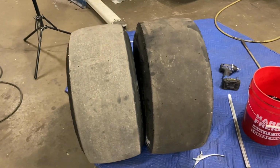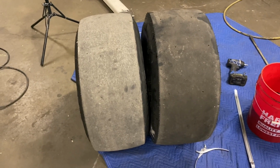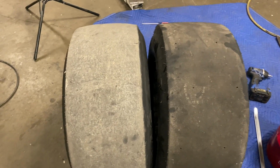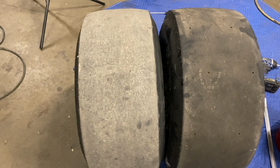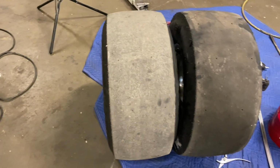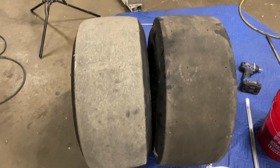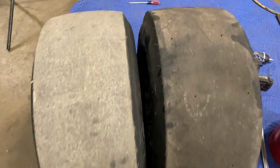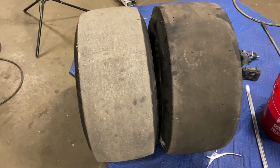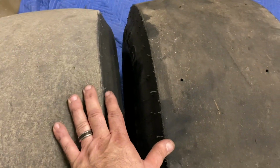All right, guys, well, that is significantly wider. Now, they're both on a 10-inch rim. It is a solid 3/4 inch wider, I think, when I actually measured it. According to the math, it's like 10.2 and 11, so it's 0.8. But that's a big difference. This is huge. So hopefully we're fixing to try to test fit it on the car now, make sure it fits. Height looks to be the same, of course, as 28 inches.